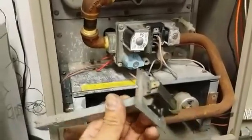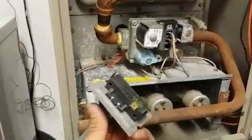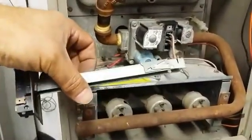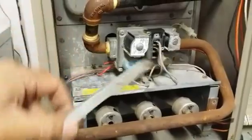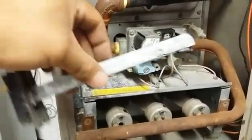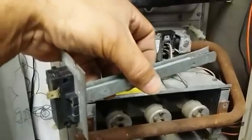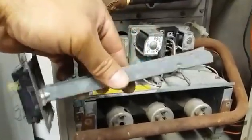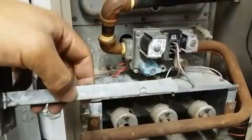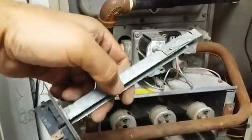The switch itself seems to have gotten unstuck again — it seems to be testing fine. I verified its operation by warming up the temperature sensor over my gas stove, and it would shut off, then cool down and click back on. So it seems to be working alright.